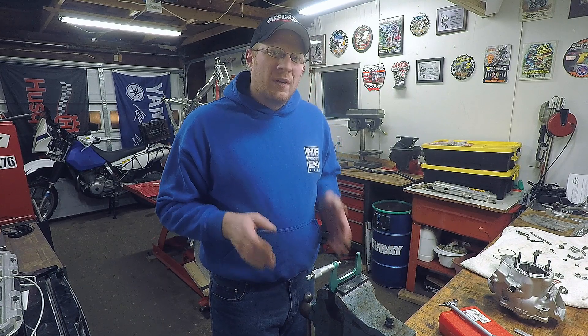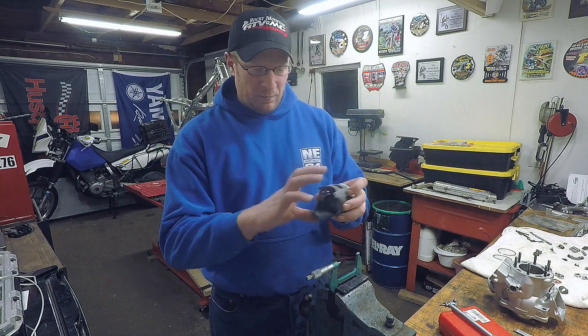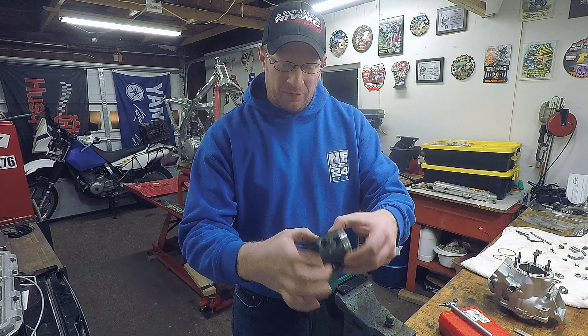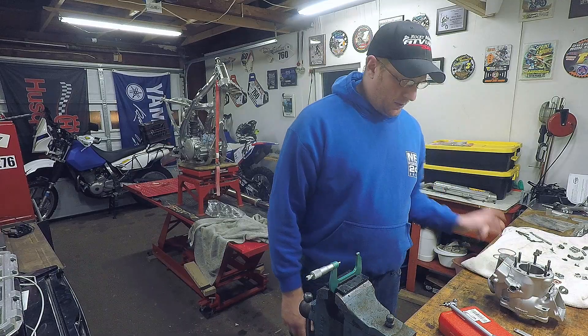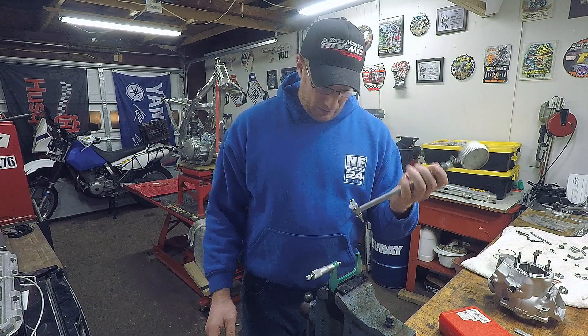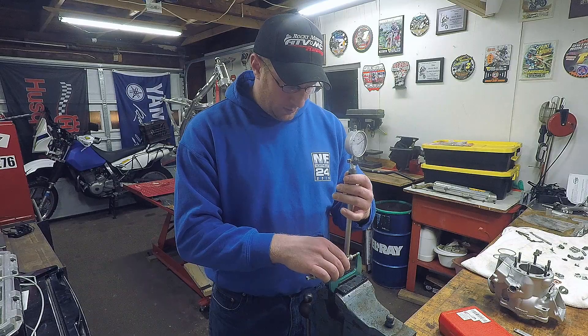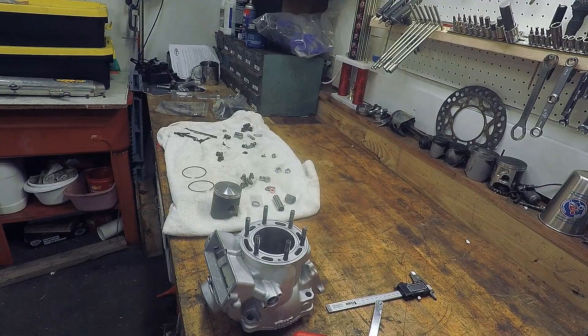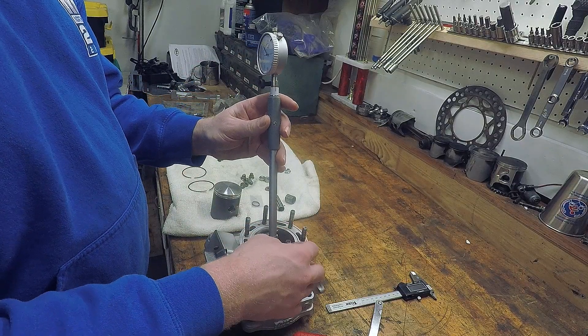For a standard size piston, the biggest limit is 2.619 inches for a YZ250. I have this set up at 2.619 and my piston measured at the skirt — not the very bottom, but the lowest spot — just passes through here. Take your dial indicator bore gauge and set it up so the lowest point is zero on the gauge. Standard piston clearance is 0.0018 to 0.0020 inches, with a maximum out-of-limit of 0.004 inches.